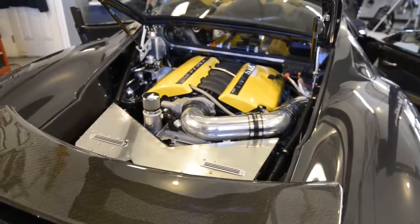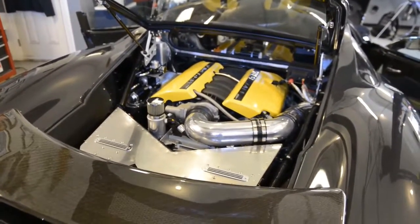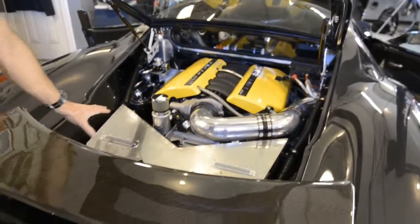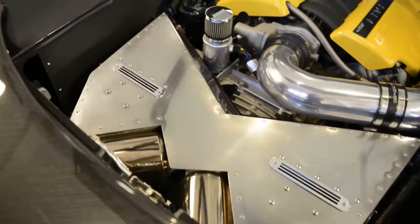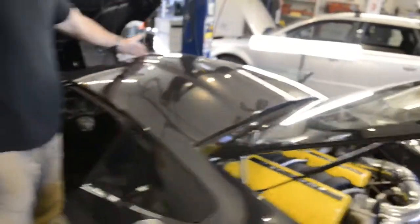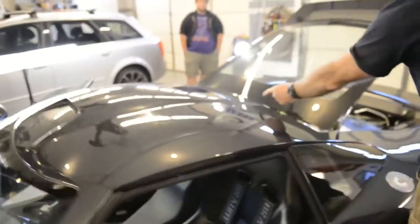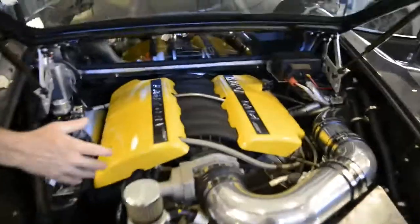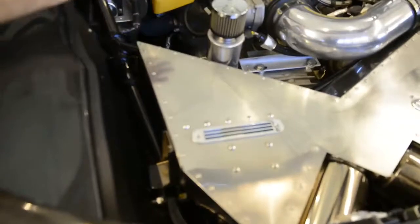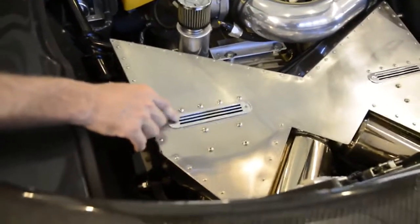You'll see a lot of aircraft hardware throughout — building a couple of airplanes, I had a lot of leftover stuff. This here is an exhaust cooling system to help pull air out of the engine compartment. This scoop is functional: cool air comes in, comes to the back, into the engine compartment. There's a water separator, so if water comes in it drains out the sides, but air continues down through. If running hot, it'll automatically turn two turbine fans on to exhaust air out the back. When I shut down the car, it will also automatically go into a cooling cycle with those fans.